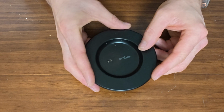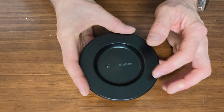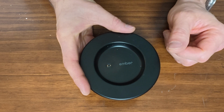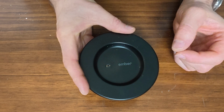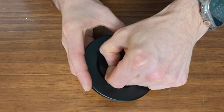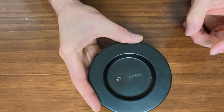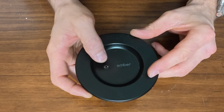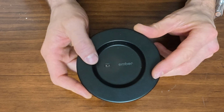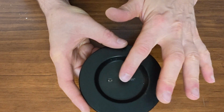And I'm gonna show you what we're gonna do. One thing you wanna do before you get going is unplug it first, because if you try to do this plugged in, you're gonna get a nice little spark between the two pins when you touch it with a metal brush. Second, grab a pair of needle nose pliers or use your fingernails, whatever, and pull that pin up that's recessed as far as you can. Pull it all the way up so that it's just about even with the other one. And I found that one of them, usually the inner one, is slightly lower to begin with than the outer one. But get that all the way up so that when you brush it, you can get all the edges.